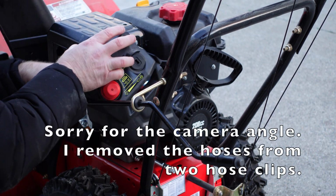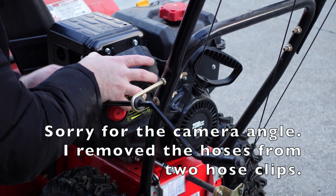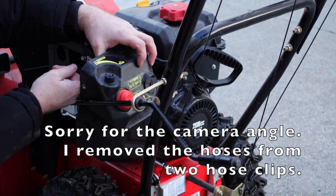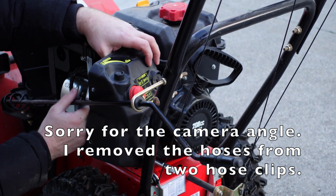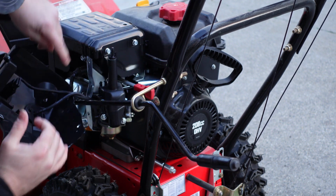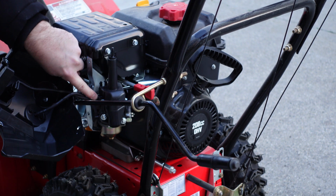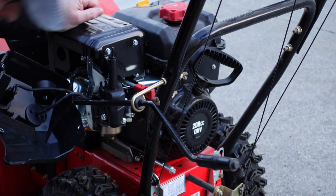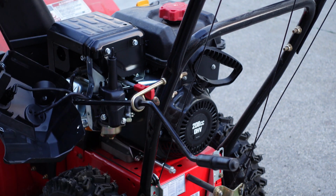I'm gonna, from this side, take it. There's just two wires here. Just gonna pop them off. They're a little clamp. There's one. There's two. There's off. I'll show you here. There's two wires there. There's a clamp there and a clamp there. So just remember which one goes to which. Okay. And now I'm gonna pop that off with the carburetor using the 10 mil again.